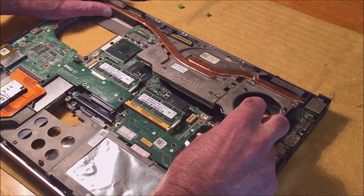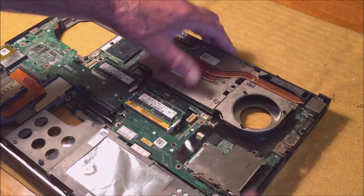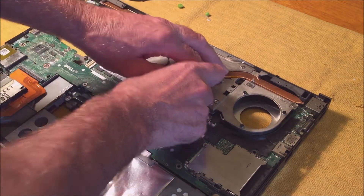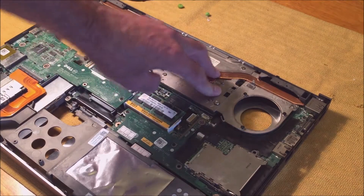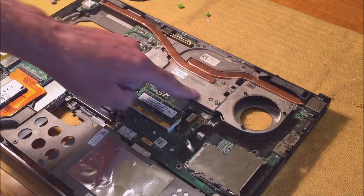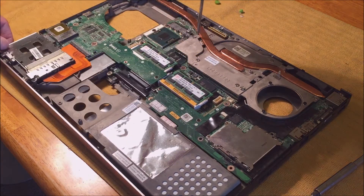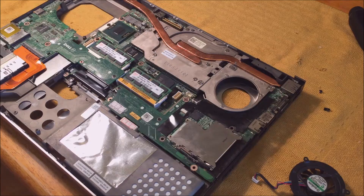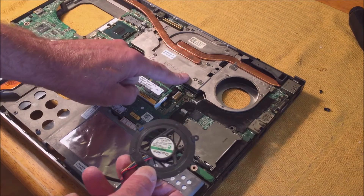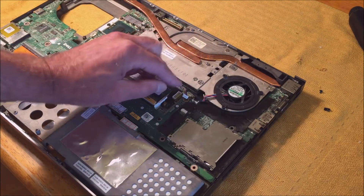Get this lined up just so the connector can push down — like that, it's connected. Tighten the other screws down to the board. I switched to a Phillips screwdriver — three places to tighten. Now I'm going to install the fan for the display board. The NVIDIA fan goes in like that and gets plugged in right there.